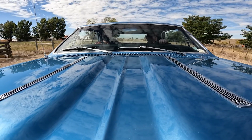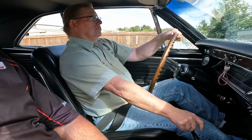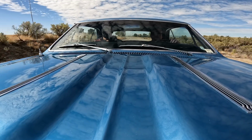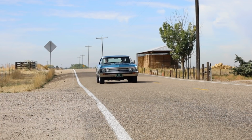Working with the guys at MDL, Bruce and James, it's just been a fantastic experience. And I also opted for their clutch package and their hydraulic release bearing for the clutch as well. So in your car, you've got pretty much a 26-inch tall tire, 373 gear ratio, pretty typical of the industry. And obviously you can go play at the drag strip if you wanted to, but then again, get on the open road and enjoy it. We're cruising around right now at about 50 miles an hour, only tacking probably about 1800 RPM, so very enjoyable. Yeah, this is perfect.